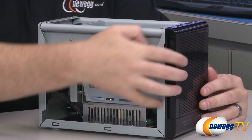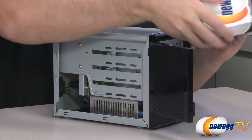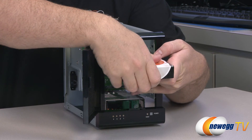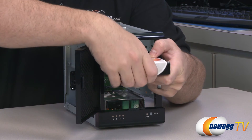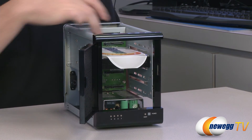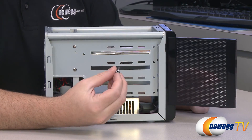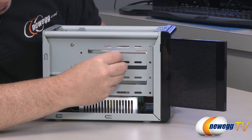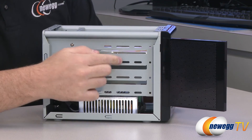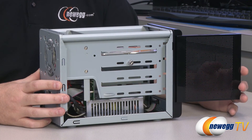Now I'm just going to do a quick demonstration here with our Newegg hard drive to show you guys how this works. You simply slide it in the front into one of the open drive bays, line it up with the rail, and it's going to pop back and actually seat in the serial ATA port at the back. Once that is in place, you can use the included thumb screws to secure the drive using the drive's mounting holes from the side — one bolt on each side should give you security so the drive won't slide around or pop out of the serial ATA bracket.